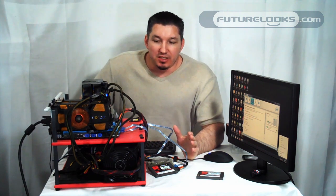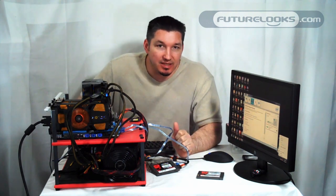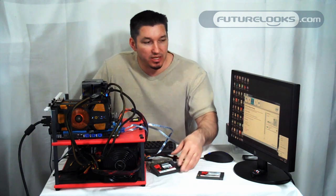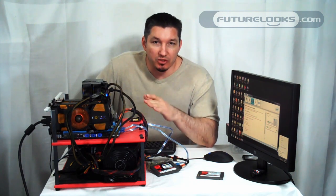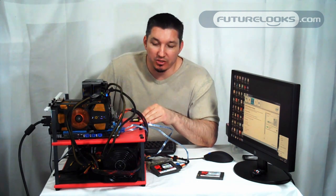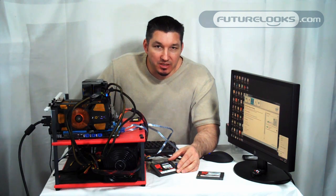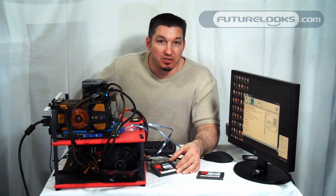We want to help out a few Z68 users out there who may not have installed an SSD already, or may not have known they had Intel Smart Response Technology built in. Now, if you go into the BIOS after plugging in your SSD and you select RAID, when you get back to Windows it's going to continue to blue screen. That's because it's looking for the driver software or registry settings that would have been set up from a fresh install. Instead of having to reinstall Windows, all you really have to do is check out our webpage where we have our Z68 article — we have a quick fix, an automatic link fix from Microsoft that can save you some time.